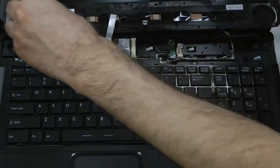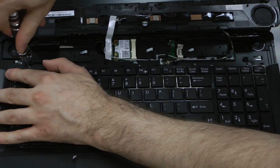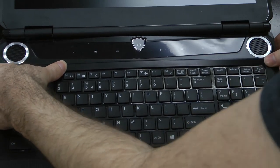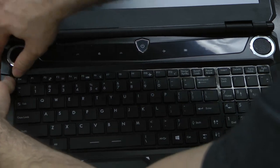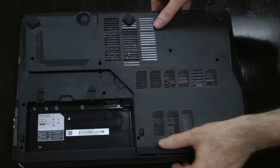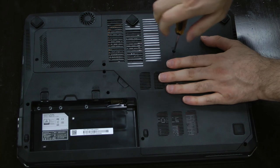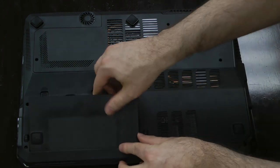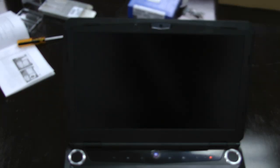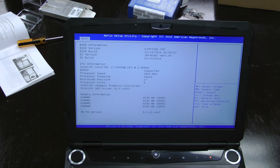With all of our hardware installed, we're ready to close up. Slide the keyboard tabs back under the palm rest, then replace the five screws at the top of it. Very carefully snap the top panel back into place. To get the hinges to re-secure, you may need to tilt the screen. Next, snap the bottom panel back on. Pay attention to the small plastic tabs on the sides of the panel. Replace each of the six retaining screws. Assuming you've done everything right and by the book, your new notebook should be ready to go. Reinstall the battery, flip it over, open the lid, and power it on. Success! Thank you for watching another how-to video with Corsair Labs Uncut. This is Dustin Skolavos, signing off.